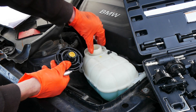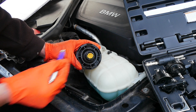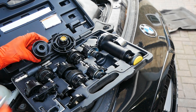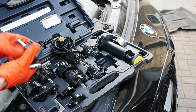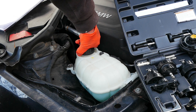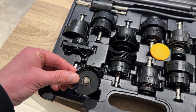We need to find an adapter that's going to fit onto that coolant tank — what we're looking for is something that looks similar to what the underneath of the cap looks like. I've had a scan through them and I think this one looks pretty similar, so I'm going to give it a try. That's feeling good — I just need to get that on there nice and tight. If your car's got a radiator with a cap on it, you can find a kit that has one of these adapters as well so you can still do the coolant pressure test.